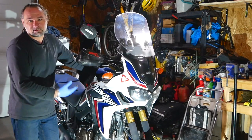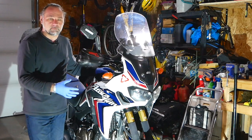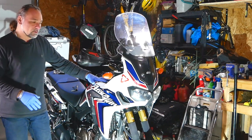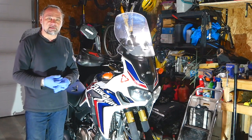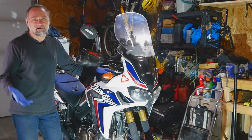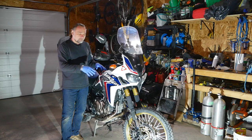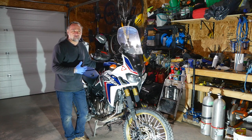Most of the time you can get away by just loosening the screws and pulling them apart a little bit if you just want to take off the fairings and get into the air boxes or air filters. For that, you don't have to remove the heat crash bars completely, just loosen them up. Since I'll be needing more room, I took it out of the way. I also have an air dam here that has to be removed as well. If you're new to this channel, don't forget to subscribe for similar tutorials. It takes a lot of time to do anything on the Africa Twin — it's pretty painful because there's so much stuff you have to take off before you get to the component you want to work on.